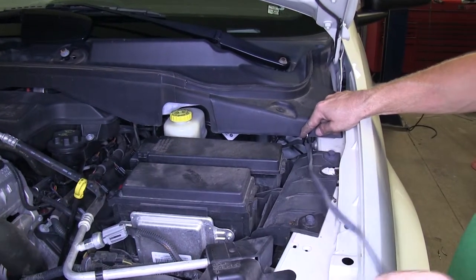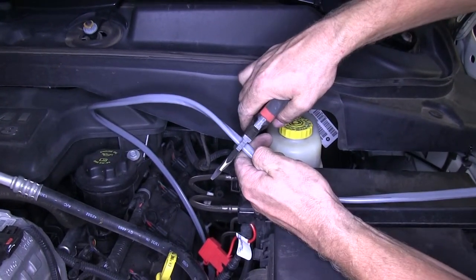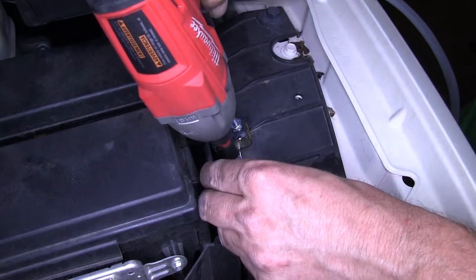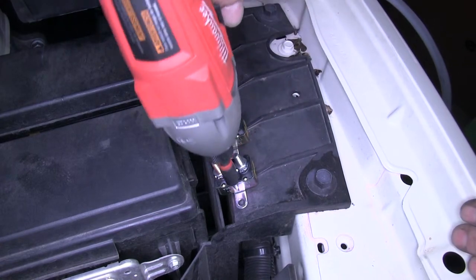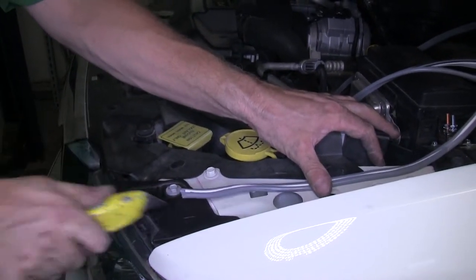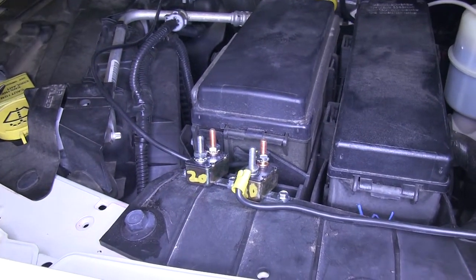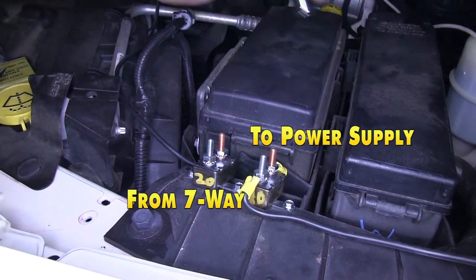We're going to connect to the 12-volt power going into the distribution box. We'll run a little extra length because we need to take the white wire in this bundle and eventually route it inside the vehicle. We'll cut to length, saving the rest for later, then install our circuit breakers — one 20-amp and one 40-amp. There aren't many good places to attach the circuit breakers, but there's a plastic bracket that seems sturdy enough. We'll split the cable, separating the black wire and white wire. For the black wire, we'll run that to our 40-amp circuit breaker — from the silver post the remaining wire goes from the copper post up to our power supply. Note that the wires going into the power supply will be connected as the last thing we do.